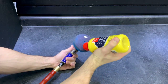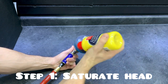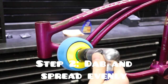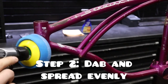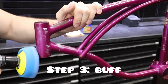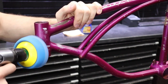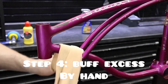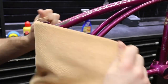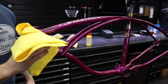In my case, I'm using a moderate amount of pressure and staying in one area, moving back and forth for no longer than five seconds. Before you touch the buffer to the paint, moderately saturate the head of the buffer — rub it in but don't soak it, because that'll cause a mess. Then dab your compound onto the frame and use the buffer head to make sure your working area is equally covered. Once covered, go ahead and buff using the proper amount of time and pressure. After buffing, come in with a microfiber towel to clean up the excess compound — this is where you'll see a fantastic shine come back. Finish off with a quick detailer wax and a fresh microfiber towel.